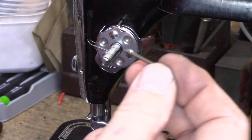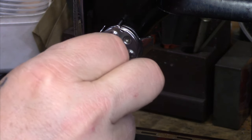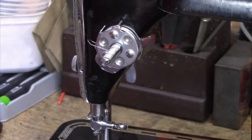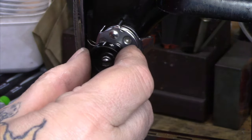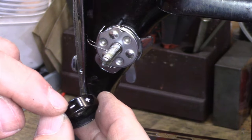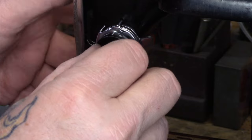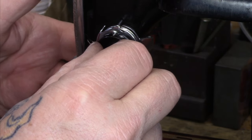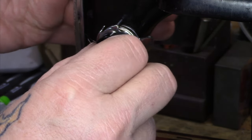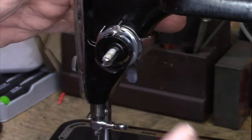Next piece — we're going to put in the pin, the release pin. Some people put that in earlier. And then I'm going to take the release plate and push it down. The release plate is also the indicator plate — it's got the plus and the minus. You know it's doing its job if the presser foot is down and then you release it, you can feel that it's coming up, and then it's good and tight again.